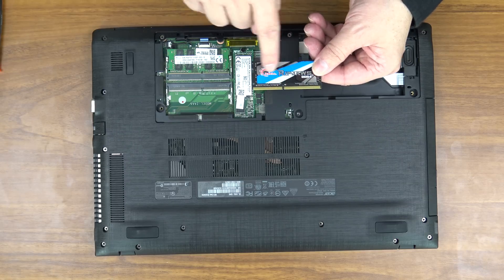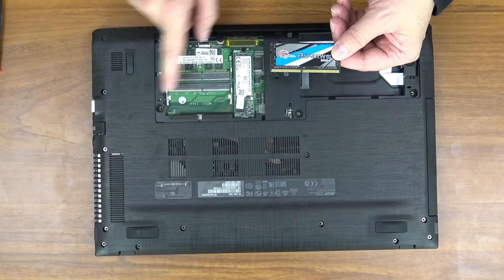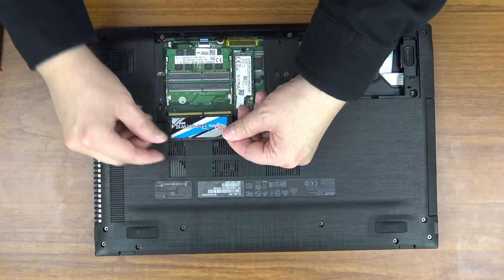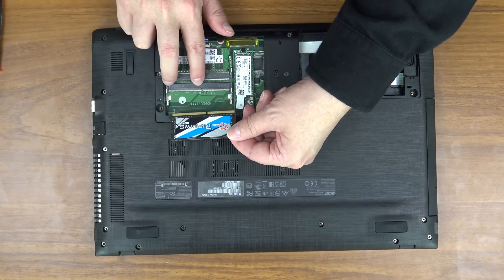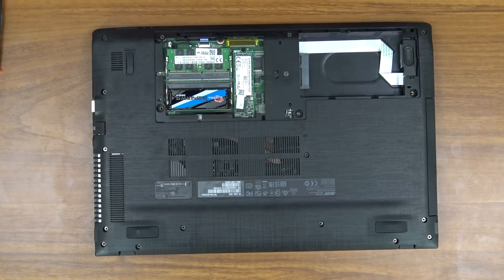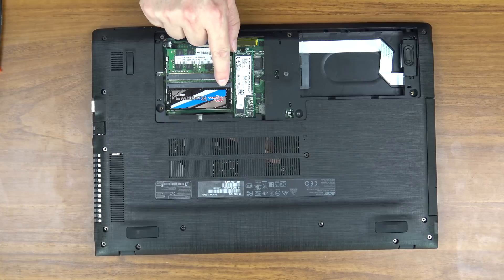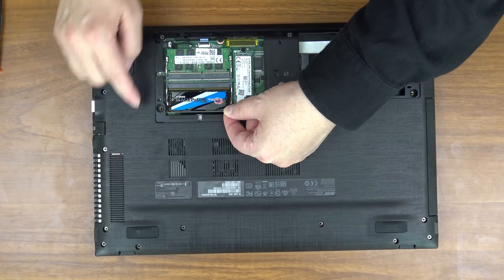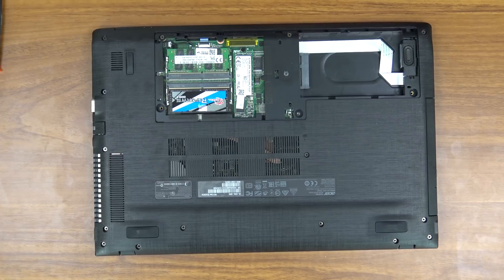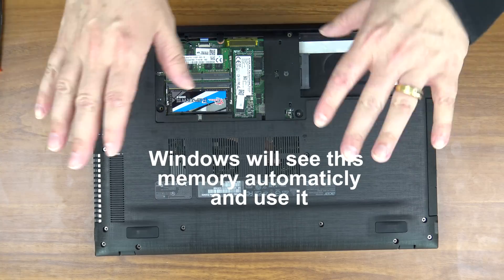It's different than DDR3. DDR3 and DDR4 are not interchangeable, so make sure you buy DDR4 memory for this laptop. Other laptops I've reviewed had DDR3 — it's different memory. Now this is where it inserts, and you want to align the notch with the slot on the board because one side is smaller than the other. It does not go in vertical, it does not go in straight horizontal — it goes in at an angle just like so. No force — that is a zero force insertion. It quite literally just sits there. But notice the golden fingers go away; if you can still see them, it's not in. You want to make sure the gold on the bottom is gone. Once it is, your memory is installed. When you boot up, Windows will see it and use it. There's no configuring to do — you're done.